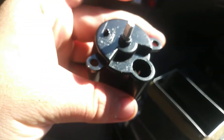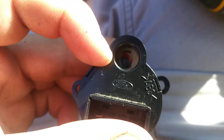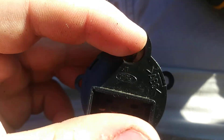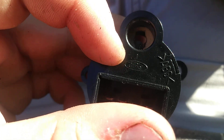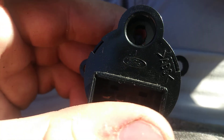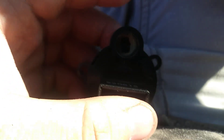As you can see I got my bezel out and I got the switch out. Back here on this side where the plug is, there will be a gray socket looking thing with a flathead on it. You take the flathead, you take the socket out, and you pull the bulb out of the old socket.